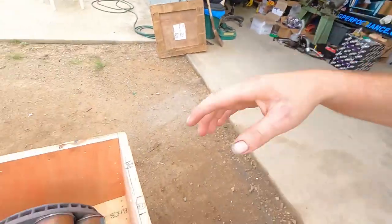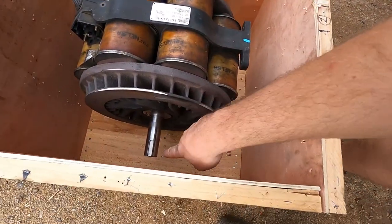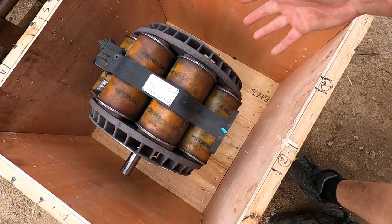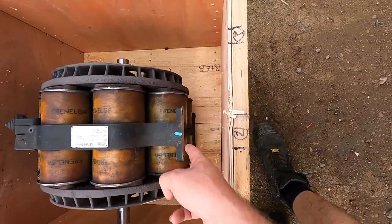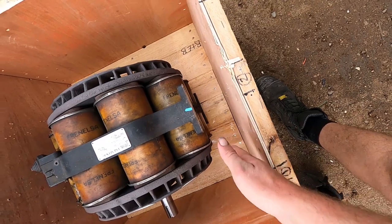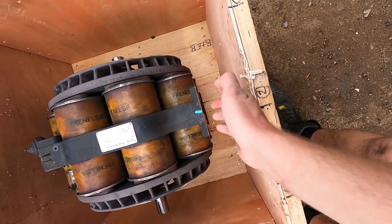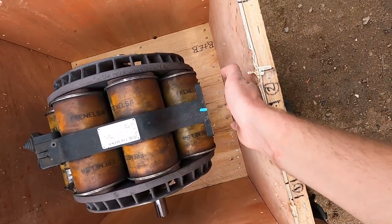To make a long story long, I'm just going to have to explain it because it's the only way it makes sense. So you've got the retarder unit here. It bolts to the actual chassis on two bearing cases on each end of the shaft, and that's the only thing that bolts to the chassis. Then the actual retarder bolts to an arm, which operates a load cell, and that's the only way the actual center of the retarder bolts to anything.